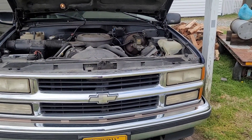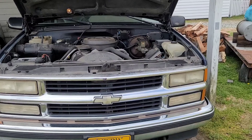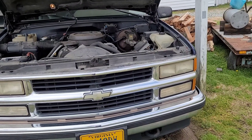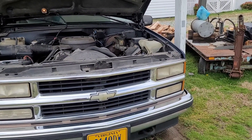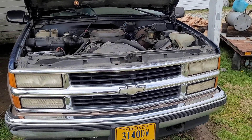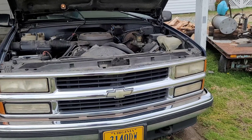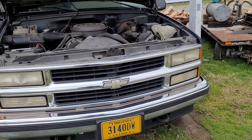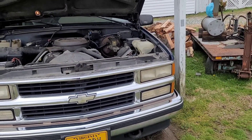The computer — although this is an OBD1 system because it's a 1995, the late-model 1995s have OBD2, but this is a full-fledged OBD1 — the computer picked up on the issue before I did. I didn't pick up on it until well after the check engine light came on. On OBD1s and some OBD2s, when the check engine light comes on it means it needs some service — new plugs, all that good stuff. I never thought it would have been the intake gasket until it started doing that surging thing, but that problem's fixed.